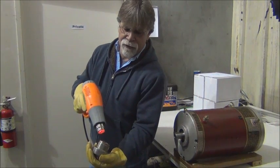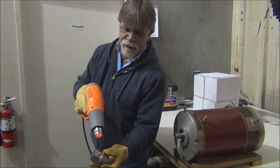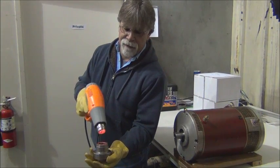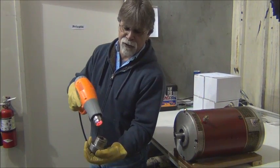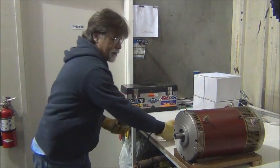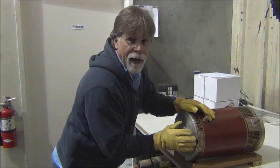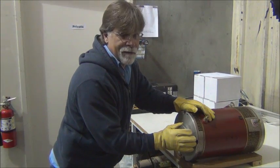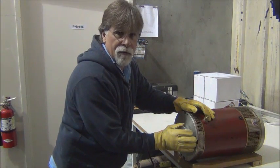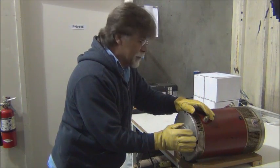Trying to draw some heat flow into the inner part of this coupler as well as the outside. It's starting to get uncomfortable — the heat gun is really blowing out some heat at this point. When I'm shooting it into the inner part of the coupler it kind of channels the heat into my palm. Let's see if it'll go. Listen for that noise — bang, it's on there. I'm going to hold it there for a bit, let it cool down, and make sure it's held in place. It slid on real easy, so I had it plenty hot.